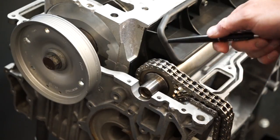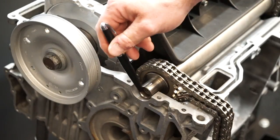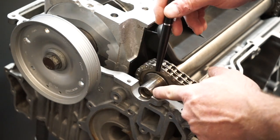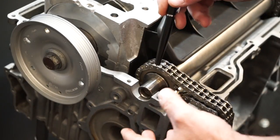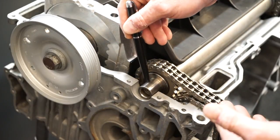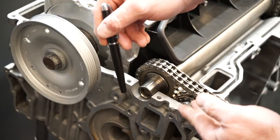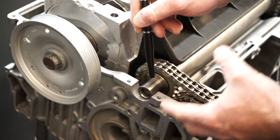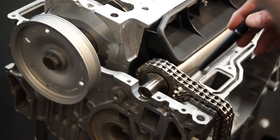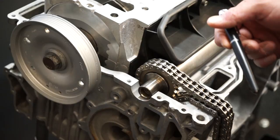On this front end, the intermediate shaft also drives the oil pump, which sits here on the front of the engine via an eight-millimeter hex key. The oil pump is in a perfect location to provide pressurized, cool, clean oil to the journal bearing right here. So the oil pump is driven by the intermediate shaft assembly and provides a solid oil supply for this closely positioned plain bearing. One would assume that since it wasn't easy to get oil to the back of the engine from the oil pump, that is why the factory utilized a different style of bearing support for that end of the shaft.